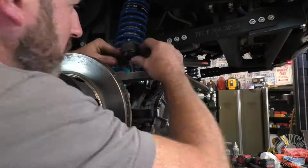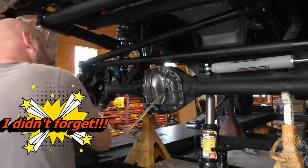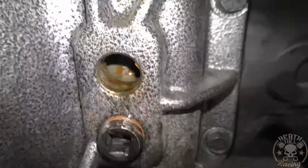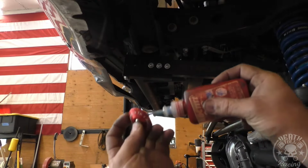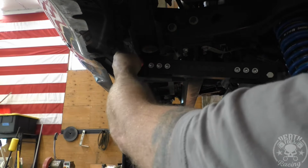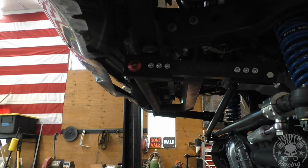All right, I'm going to change out one of my boots that had a hole in it, the tie rod boots. So I'm going to put a link in the description below for those boots. For some reason, they're not listed on the Energy Suspension website. So I got a link below. Blue Loctite on these caps because those technically could come loose if you don't put Loctite on them, since they're stopping against a fake joint, if that makes sense, where the link and the axle tube end.